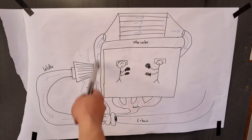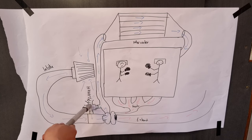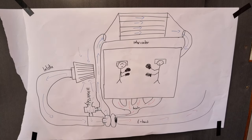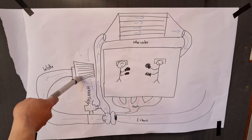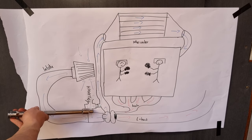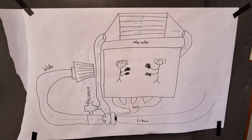When the air gets recirculated, the next time you're on the gas, there's some air ready to be sucked through the turbo and sent to the engine. When you have a blow-off valve — and in my case a fully adjustable blow-off valve — you can adjust the aperture on the venting side. Air will come through, split off through venting to atmosphere giving you the sound, or it will get recirculated. If you want full venting, you just block off this recirculation port, and when the air comes back it only has one exit — it will just vent and give you a very loud noise.